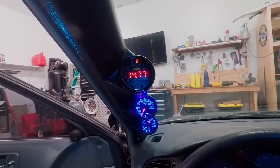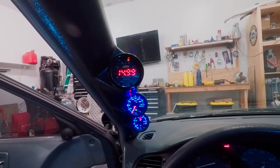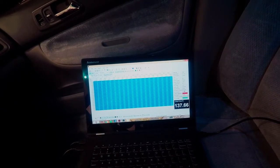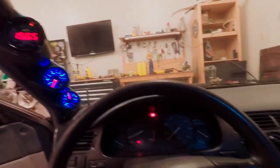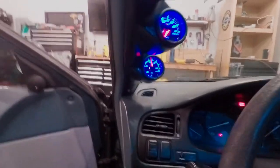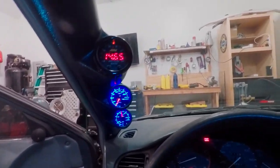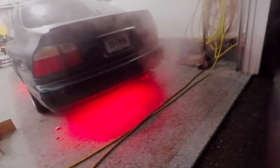Our air fuels are starting to dip down a little bit. Air temperature is 49 degrees so we are heating up - sensor's working. Coolant's at 137 so we're not quite up to operating temperature yet. Everything seems to be working, but we're getting a little lean - I think this section of the map below 1000 RPM is too lean. This thing is starting to fill up the garage with some smoke so I'm going to have to turn it off.